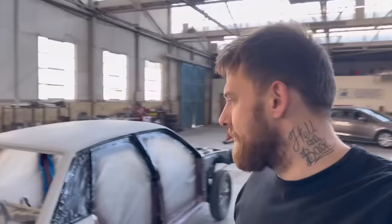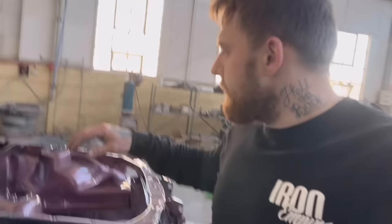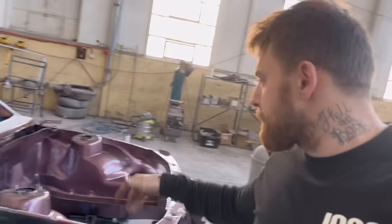So what happened? Laying all the base of the pinky colour, last coat in the bay, I was getting a bit sloppy, getting a bit late. Put the lid on the gun, but put it on at a bit of an angle so it wasn't really sealing evenly. Spraying the bay out, heaps of drops of base went all over the fucking engine bay.